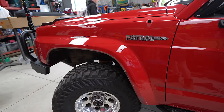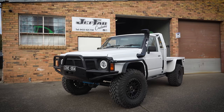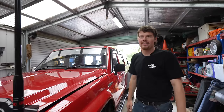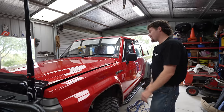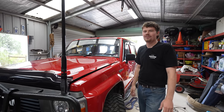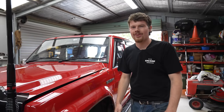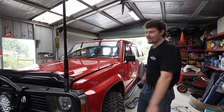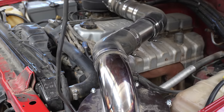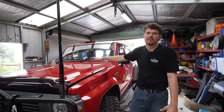That leaves us with a guard entry. There are lots of types of guard entry, and if you watched Liam's in-store with Jeff Babb on his GQ, they did a pretty cool custom short entry stano — really neat, but a different style car. You've got a long entry stainless that runs right down the guard. The stano thing doesn't really suit what I want with this car, and a long entry kind of looks like a bit of storm water pipe — just a bit too much tube going on. The reason I want to enter here is I've got my air box mounted in this corner of the bonnet.